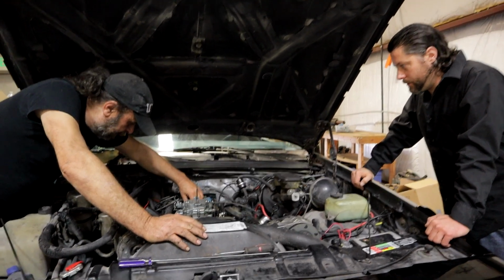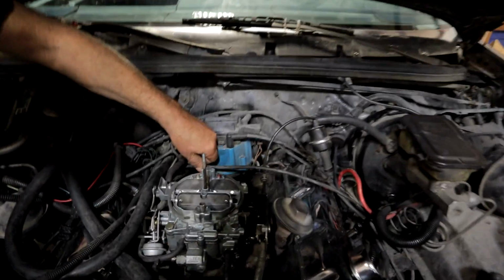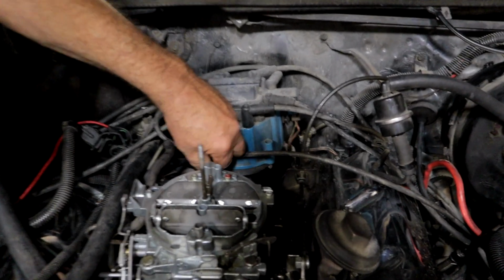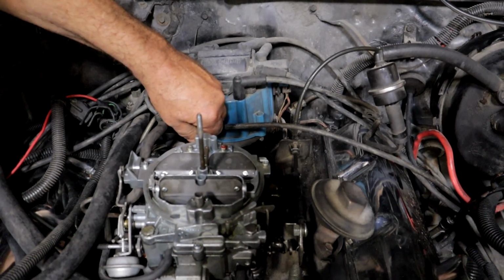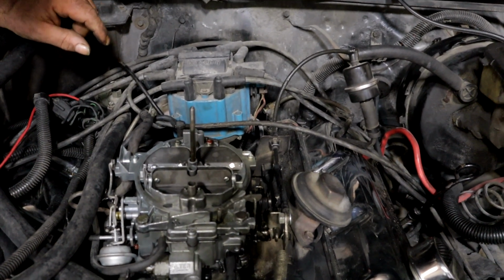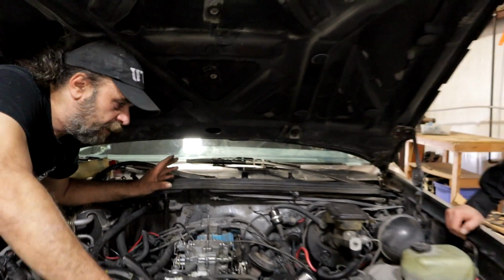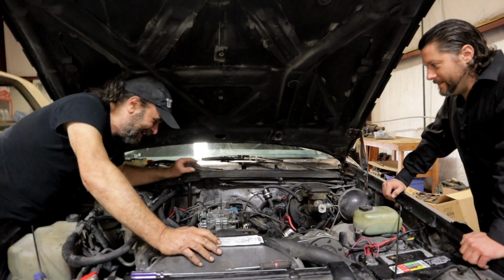And this line here that you got to the vacuum modulator, this is loose. So we got a little bit of a vacuum leak from here too. I think that's the wrong size fitting, kind of like the same way you had with the... correct, yeah. But we've got this thing to where it's close enough for government work, right?